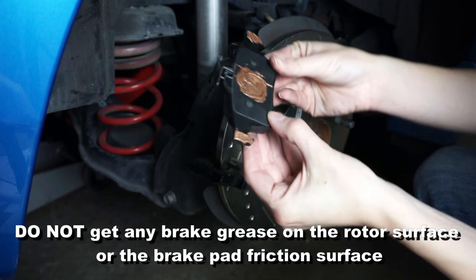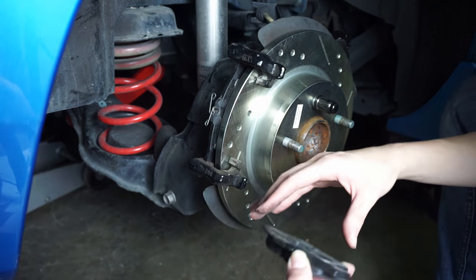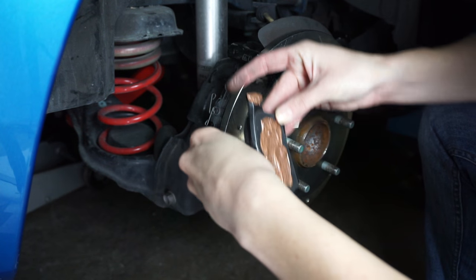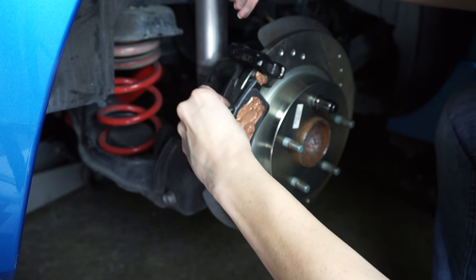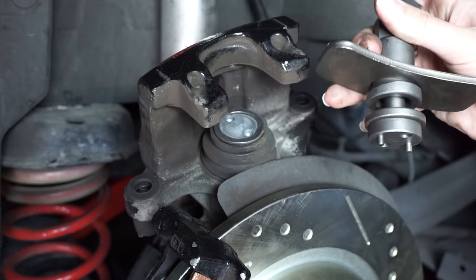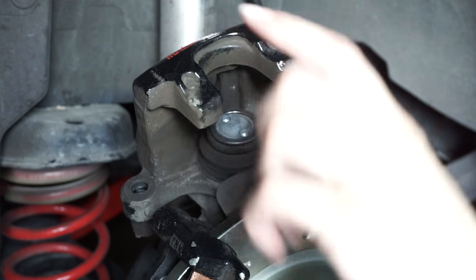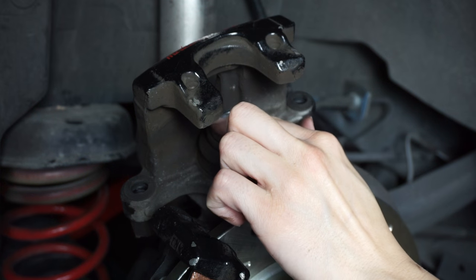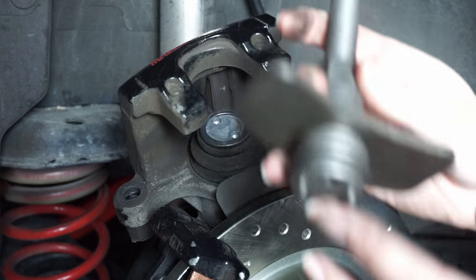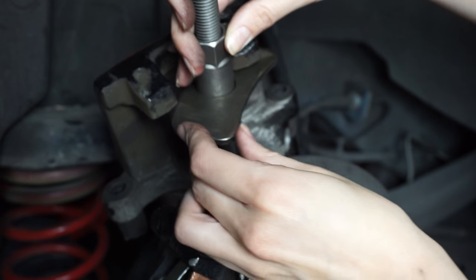The one with the pin goes in the back. Now the other one. Now for the more difficult aspect of the job, we're going to be using our tool to spin and compress the piston back into the caliper. A lot of people clamp and remove the brake lines because it makes the piston spin down easier, but we have steel brake lines so we can't do that — but this tool really already makes the job pretty easy. The tool has these two pins at the bottom that go into these two slots here, so I'm just going to place it. This is how it's spun.